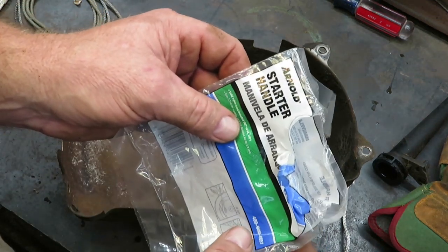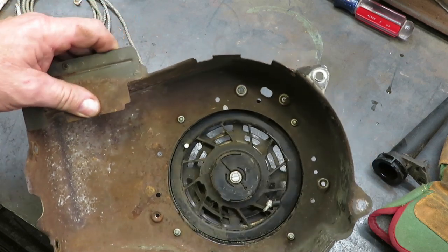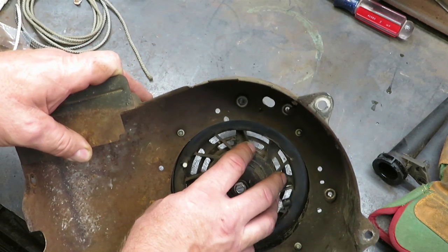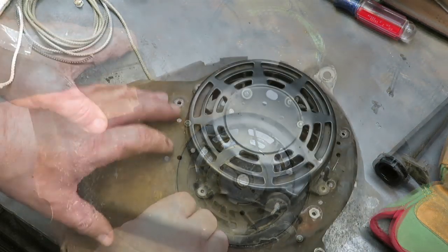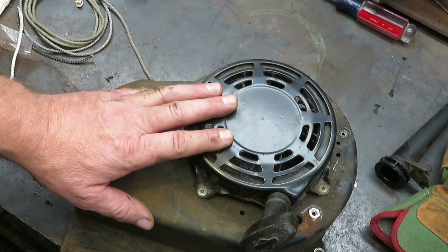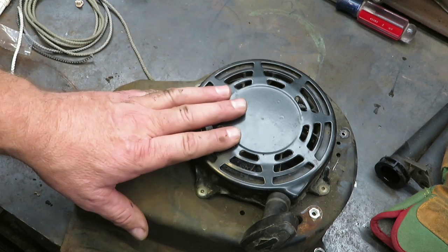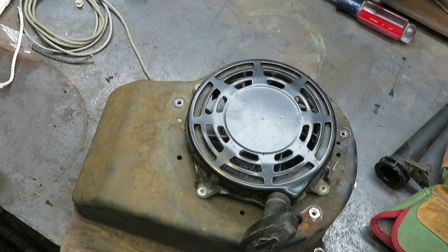I think this rope was 88 inches long and I cut off that much — so four feet of cord is really good enough. You don't need all that cord in there; if you wind it up four or five turns you're going to have more than enough rope to start your engine. That's how you change the pull rope or pull cord on top of your lawnmower engine — pretty simple job, don't hire nobody, you can do it yourself. Just keep track of your bolts, get one of those little magnetic trays, and put them back in the same holes. Thanks for watching — don't forget to subscribe, leave me a thumbs up or a comment, till next time.